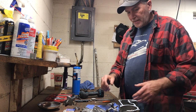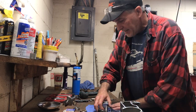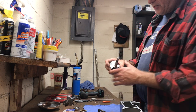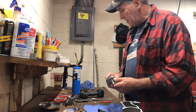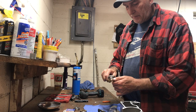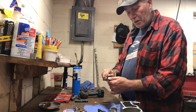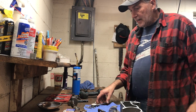Getting back to the Neotec 660 clone — split the case, here's what I found. When I pressed the crankshaft out of the bearings it came out curiously smooth. I measured the crank journal and matched it to an OEM, and it looks like it's about a half a thousandth smaller in diameter on both sides — both flywheel side and clutch side.